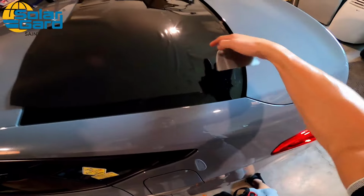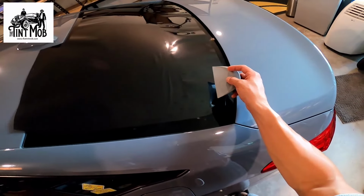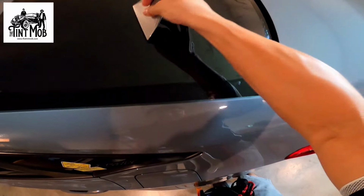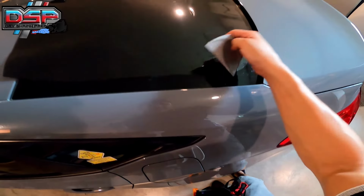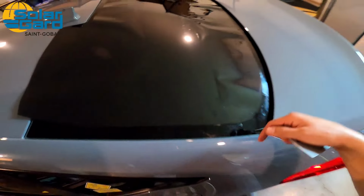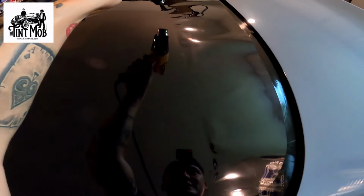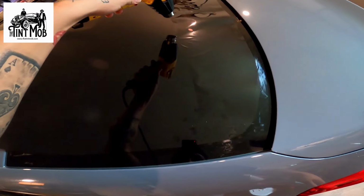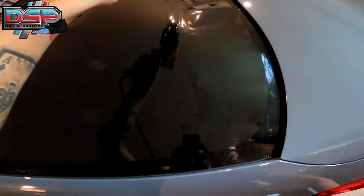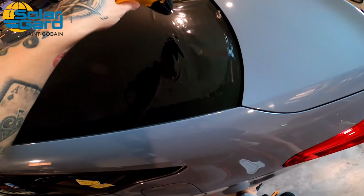So we're gonna card just to the top of the next fingers. We're not gonna card into the fingers, right? We haven't shrunk this area. So if I go down in there, there's excess of film, hence fingers, and I'll end up creasing there. So we don't wanna go into this area. We just wanna go down to the top of the fingers. Okay, and if you see it kind of swooping up and down, you can throw a finger down, just kind of straighten it out, but it'll straighten out. Again, the next 2 or 3 inches, we're side by side, waiting for that film to shrink, a little squiggly, and we're moving on. Squiggly, and we're moving on.